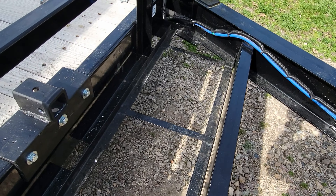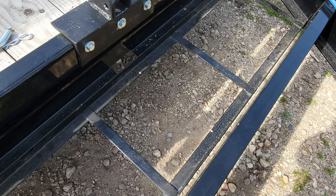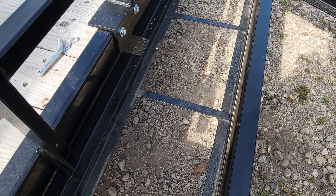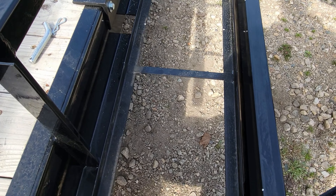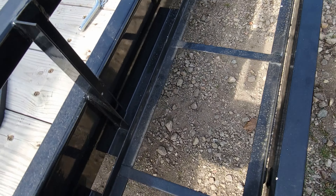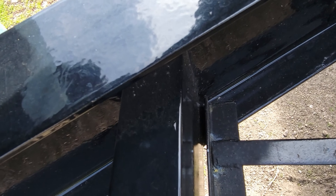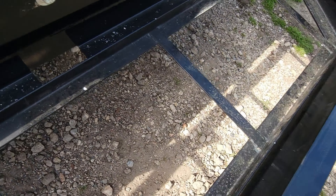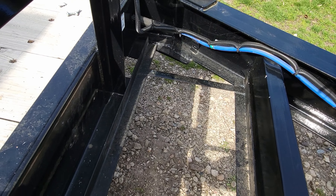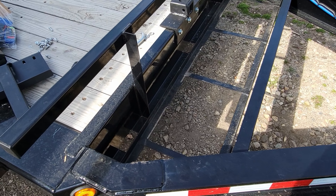Here's the little bracket I fabricated to fit in here. It basically goes from one end to the other, made it a little over 15 inches wide, with some supports in the middle — it feels pretty firm. What I wanted to avoid was welding on my new trailer, so I'll be drilling some holes and bolting it in on all four of those angles.